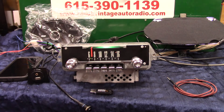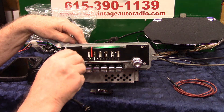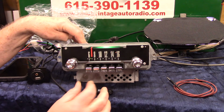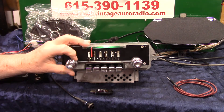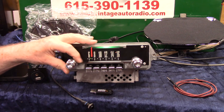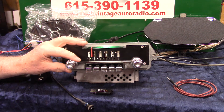Now you have individual setups — you can set your treble, mids, bass, loudness, subwoofer, and you have a crossover built in. I've already set this, but we're going to go into it. Toner control — back it up just a little bit. Three quick taps and hold: EQ on. Clockwise move: EQ adjust. Clockwise: Treble adjust — plus 8 dB. We set our treble up for our EQ — you can hear the difference. Stop, she'll set it. Treble set — plus 6 dB.